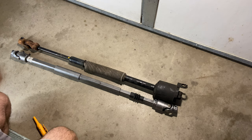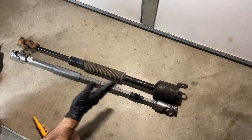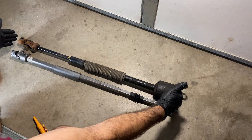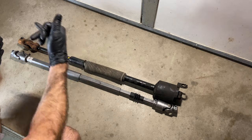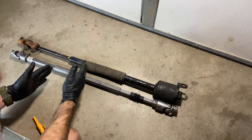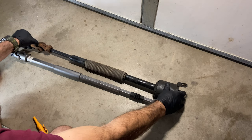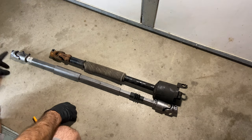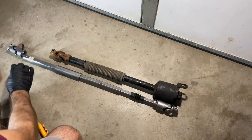I've moved inside because of obnoxious cicadas. We have two steering shafts — the Borgeson one is too long because it's fully collapsed and the stock one isn't. A steering shaft needs to be able to collapse because in an accident you don't want a solid steel rod impacting the driver — you want it to collapse and save the driver. The easiest way to figure out how far to cut is to collapse your stock shaft all the way down. That's your best indicator of what you want to imitate.